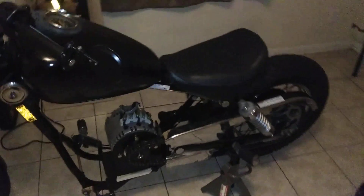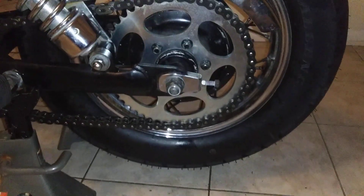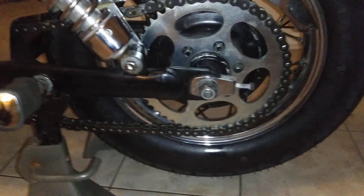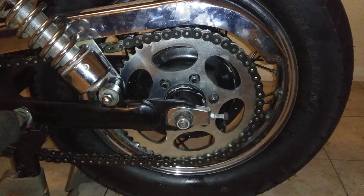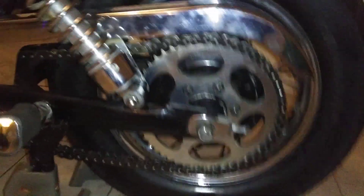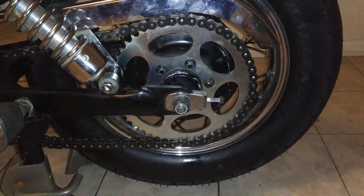What's good YouTube, time for another update on a brushless electric motorcycle build. This episode I went ahead and added the rear sprocket. I picked up a 52-tooth sprocket — it was for a 2001 Suzuki Katana 1100 — and it fits right over the hub on the Savage, a 2003 Savage, which was originally a belt drive.